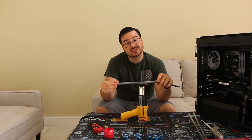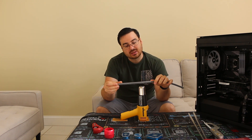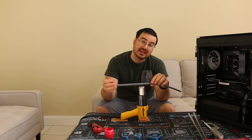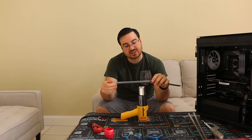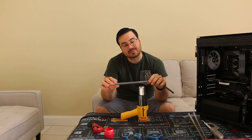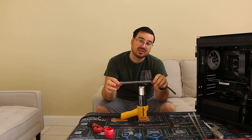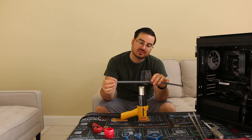Now, one thing with hard tubing — it does take patience. Make sure you're patient and doing it evenly. Now keep in mind when you do the bend it is stretching it out, so on the outside of the angle you're going to want to get that area heated up more because it has to stretch the most. Since the acrylic is more similar to glass, it's going to take a higher melting point to start bending it than the plastic. You see it's starting to bend there? It's starting to bend under its own weight — I didn't even try bending it yet.